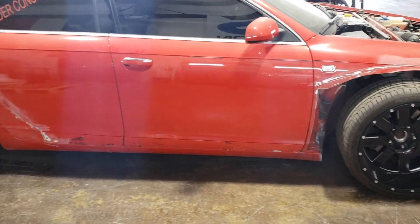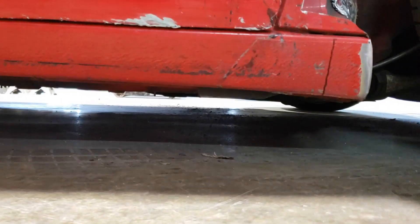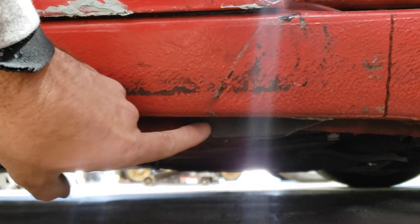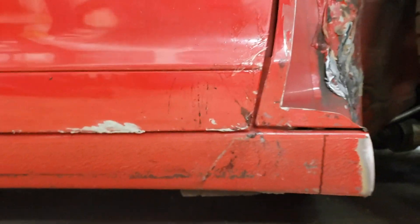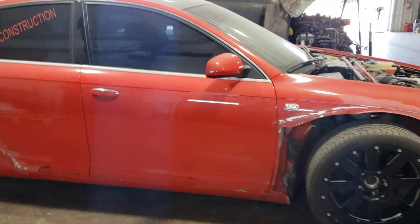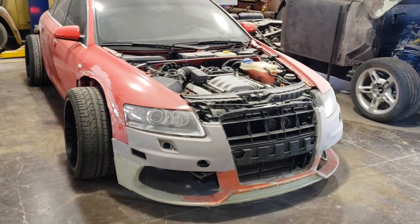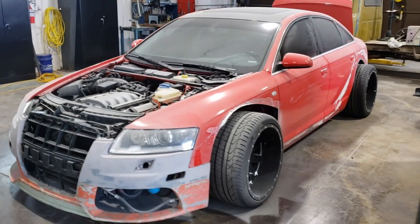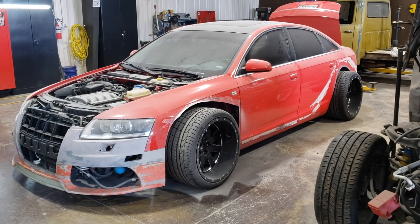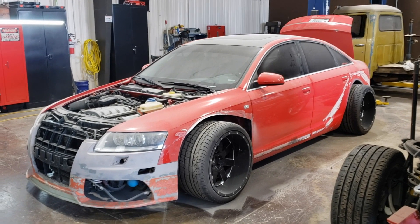What I'm going to do now is build some blocks. Anybody who knows Audis knows they have these jack points under here — a plastic block under there. I've measured those: they're about four inches from the ground in the front and four and a half inches in the back, and that is the driving height. So I'm going to cut some wood blocks, raise the car up on the suspension, shove those blocks under there, set it down onto them so it cannot move, giving us a set point we can be sure is exactly the same all the way around.